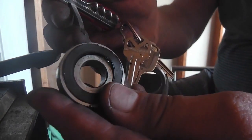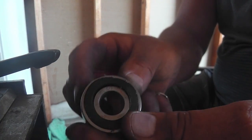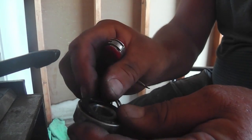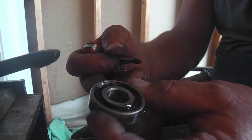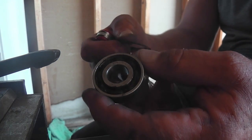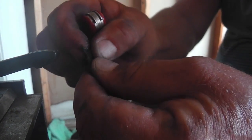Okay, there. See, it kind of makes a little potato chip wave if you do it well enough, and that's well enough to pluck. I went to the outside and plucked it up, and you can flatten it back down, and it will seal well again and look well. But there's a well-packed bearing. This is not how they look when you buy them, but make sure you do that. If you're going to get the Chinese ones, they're priced well, the quality is good, but they're just not well packed with grease. So, you know, pluck out the seal, straighten it back up.